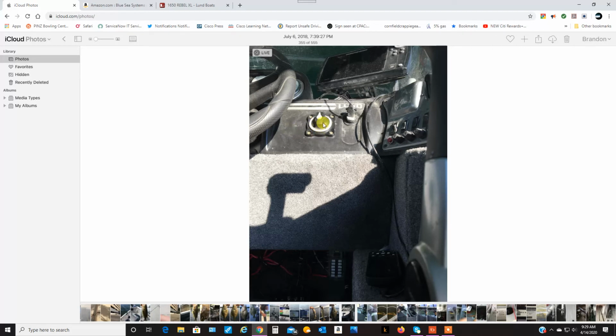So that's a much simpler way of wiring than adding another one of these rocker switches. Now some of you might be asking, why didn't I tie all this to the switch panel? Well, you open this up, I found a negative bus bar, but there were no extra connections to wire into the positive. So I could have actually used the negative bus bar for this, but I ran one that has positive and negative, just a separate connection, and that makes sure everything's fused properly as well. And it makes sure it doesn't overload my negative ground.